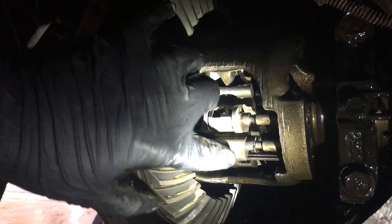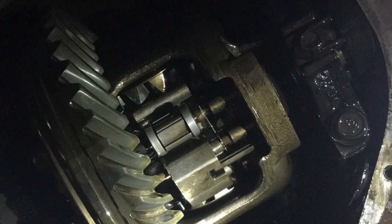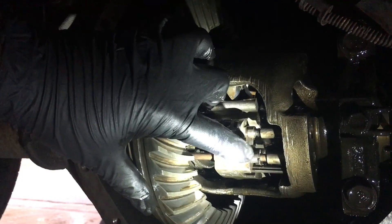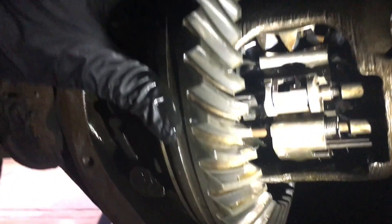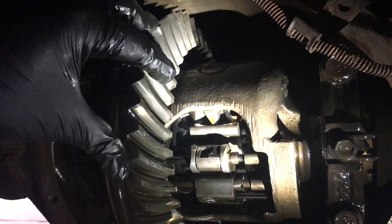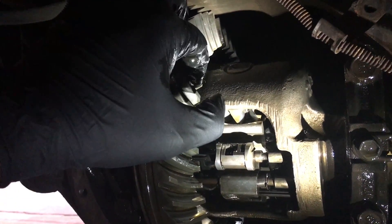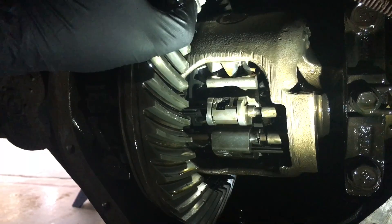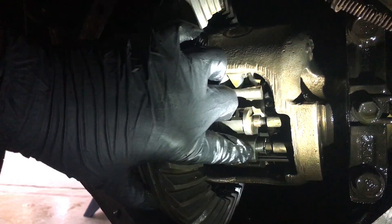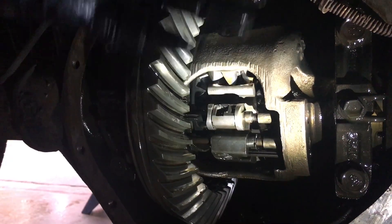It used to land right here. So I've bent it around and through there — I've bent it around so that there's much more tension on it. I was having trouble with both wheels spinning pretty good and then still spinning after 20 miles an hour, or even less, and then going back to open and not working right. So putting more spring tension on this should keep this weight from opening up until, I hope, 40 miles an hour or so.